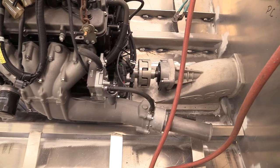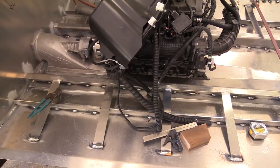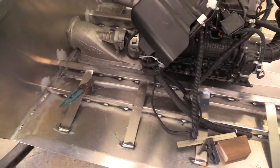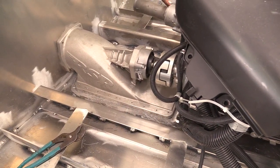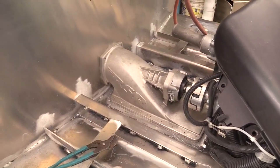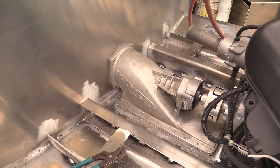What Ronnie said was true — I was going to have about an eighth of an inch clearance, but that eighth of an inch isn't there for me right now. Every install is going to be a little different. The intake weld-in ring is level with the bottom of the boat. The thing that sucks is I already cut the hole in the transom, but if I raise it, it won't be that much — maybe 3/16 of an inch.